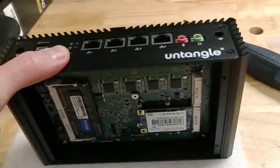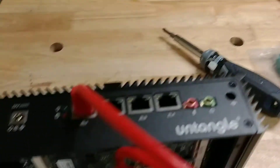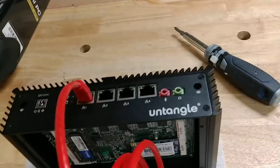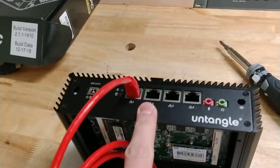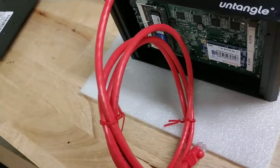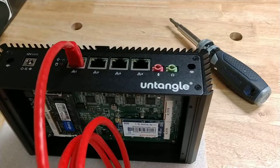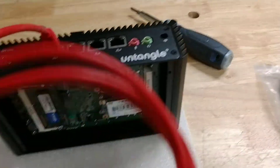Your network ports on the front are as follows. Port 1, out of the box, you can do a cloud connect — however, that cloud connect is assuming you are getting a DHCP address. The secondary port is going to be on your LAN, so your laptop is going to plug into that. Once you boot up, it's going to grab a DHCP off of port 1, and it'll assign a DHCP — or you can do a static — on port number 2. You'll want to assign an IP address of 192.168.2.100 when you start up if you're going to go into the management LAN locally. Otherwise, you can access this through the cloud controller — you'll input your model and your serial number and this will call back, provided your WAN connection is on DHCP.